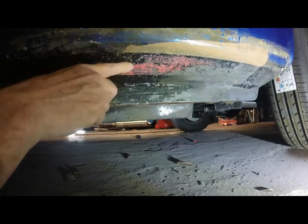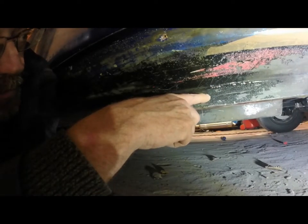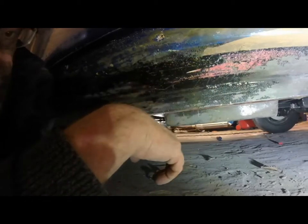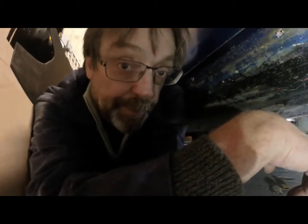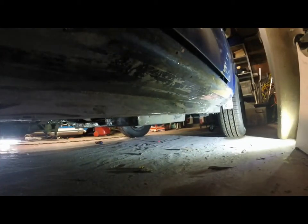So yes, I created this thing by packing tape, the shape of the sill as it is, and spraying grease. And a fair number of layers of fibre were put on there, maybe about three or four, I can't quite remember now. All the way along here, of course I had to do the whole length. And yeah, that's how the mould was made for the new sill.